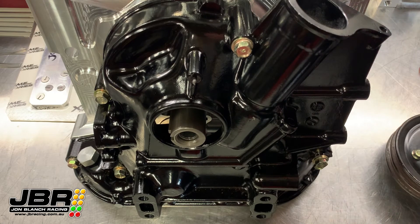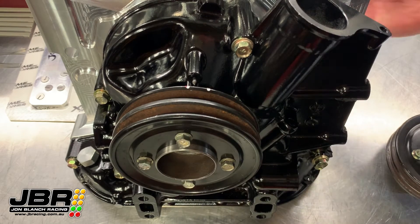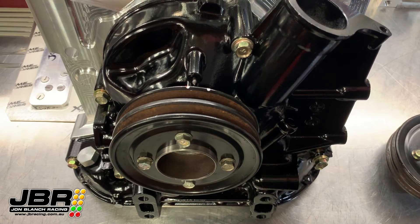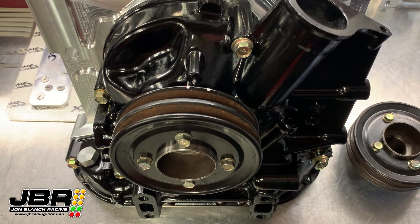Here's another one on the other end of the scale — that's probably closer to around 15 degrees after top dead center. So just between those two pulleys there's around about 35 degrees difference. That's a good indicator of just how easy it would be to lose an engine if you were relying on either of these two pulleys to set your timing. You're going to be in strife and your engine's never going to be right.